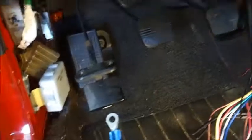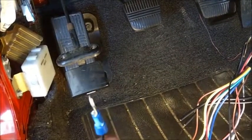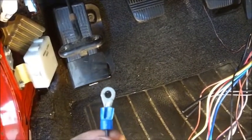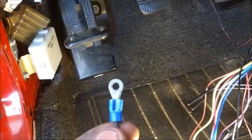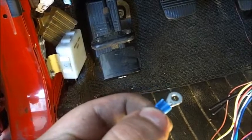Here's my scraped ground location — scraped down to bare metal with a flathead screwdriver. Sometimes it'll look like it's metal but it's really just primer, so make sure you get down to the nice shiny bare metal. When you do your ground, use a ring terminal and Klein-style crimpers. You can see it's nicely crimped — I'm yanking on it right now and it's not coming off. Try to stay away from those cheap three or four dollar crimper-stripper combos from Walmart; they don't crimp very nicely.